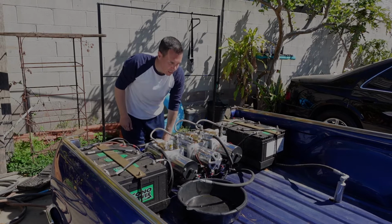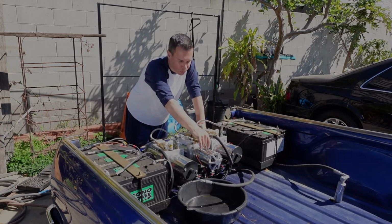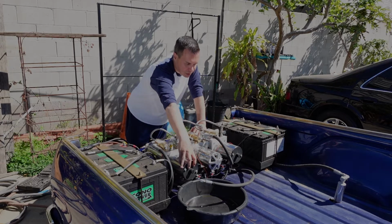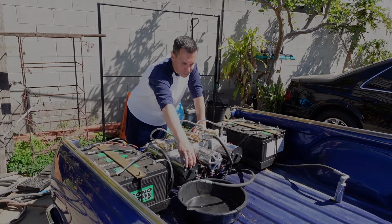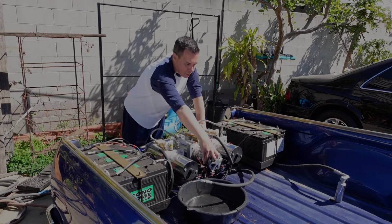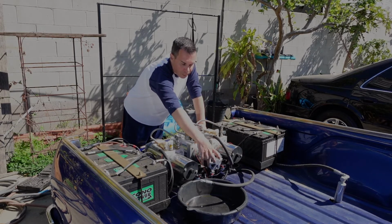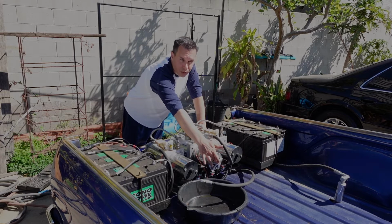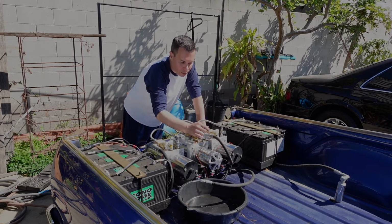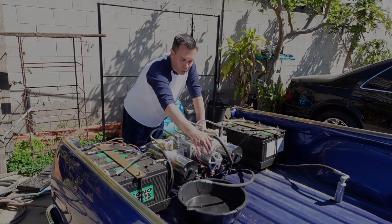And basically in any hydraulic setup, the motors are nothing more than basically a starter motor. Some of them are more standard, like these two on the end, you'll see they have a black end cap. These are more basic, like a true starter motor. Some like these, you'll ask what the difference is. It has open fins, basically to allow extra cooling, and then they usually have a ball bearing end cap, also to allow the motor to spin more freely, which also reduces friction and keeps them cooler.